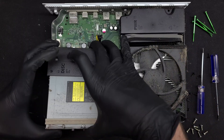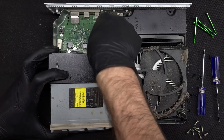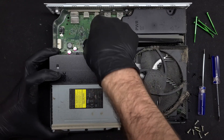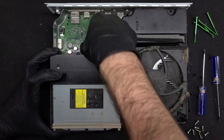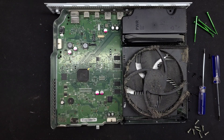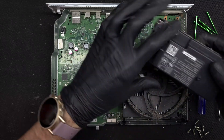The disk drive is the next component to take out. It also has one of the awful SATA connectors along with the basic power connector. Finally, the internal power supply is free to come out after some prying to unclip the connector.